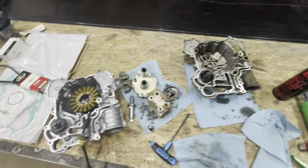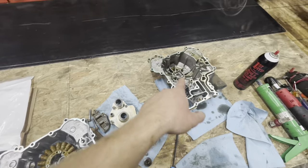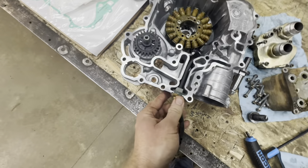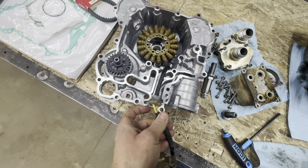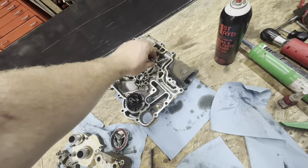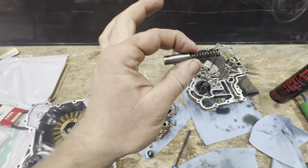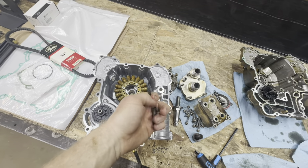After you get your side cover off you've got your new one in the box. You're going to have these three bolts to take out, swap from your old one to your new one. I put some Loctite on them and tightened those down. This wire loom sits in a grommet there - you're going to want to get some good silicone, make sure you get that nice and clean, and put a little bit of silicone down in that so you don't have any oil leaks going back together. Don't forget to put the check valve back into the new one so you have oil going into your oil filter - a little spring and slider goes into the hole.